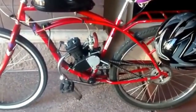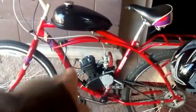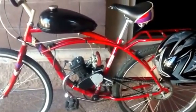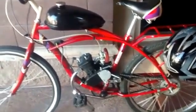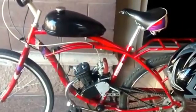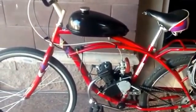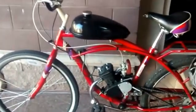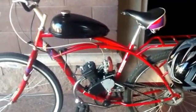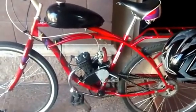Overall, I would say probably the second click down and an expansion chamber, right on the little stock motorbike here, would probably be optimum. I came up here and back yesterday — that was 56 miles — and didn't even use a fifth of the gas since I switched to the big tank. I came back up here today and it's probably a little above half right now. Going back, I'll probably use about half a tank total — that's 116 miles — so I'm definitely getting over 100 miles to the gallon now.